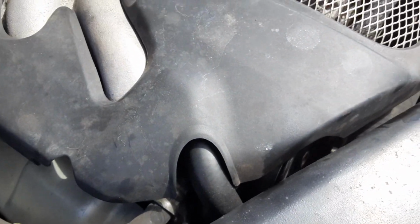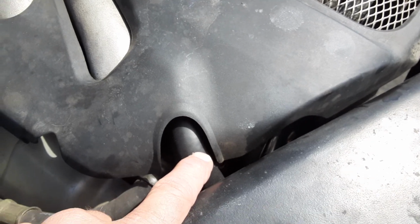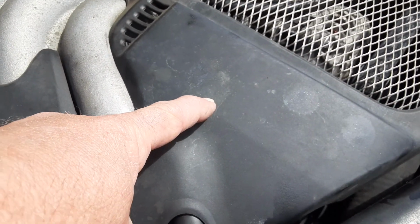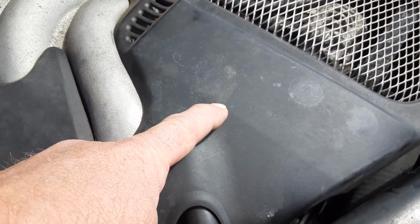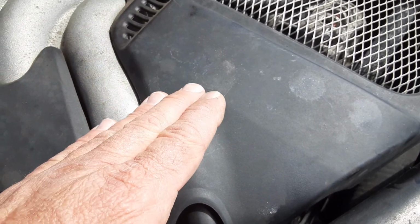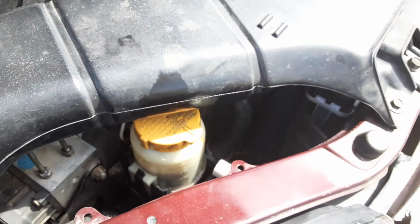It could have been this line, because I changed it, but once I changed it, I still had air in the line. I had bled it properly and done everything, and it got air back in the line. So then I took a Harbor Freight O-ring set, and the O-ring appeared to be a little bit large, but once I bolted it down, it was fine. It bolted completely down to the top, and now I have the smoothest steering ever.